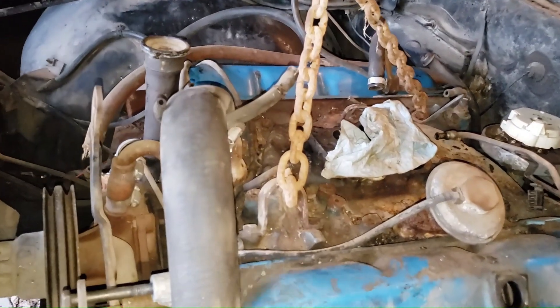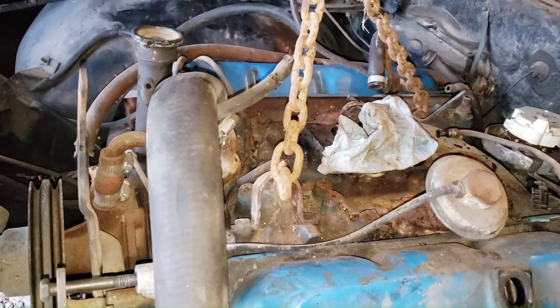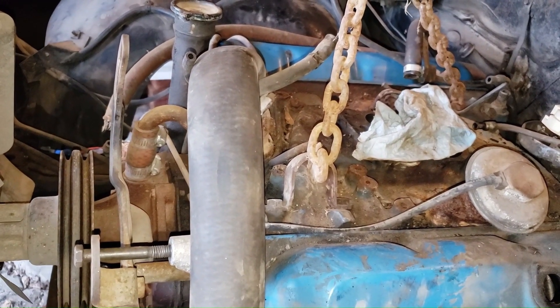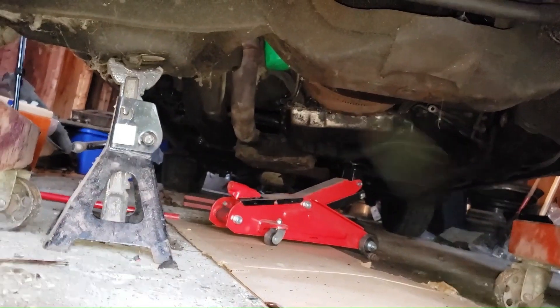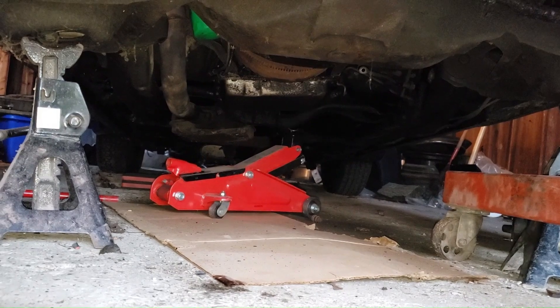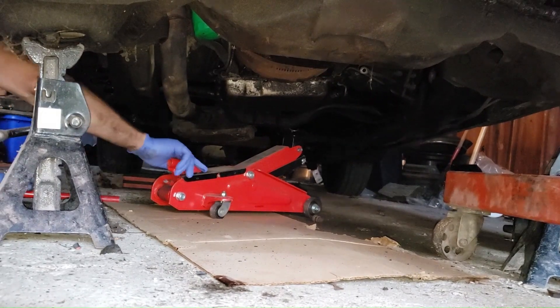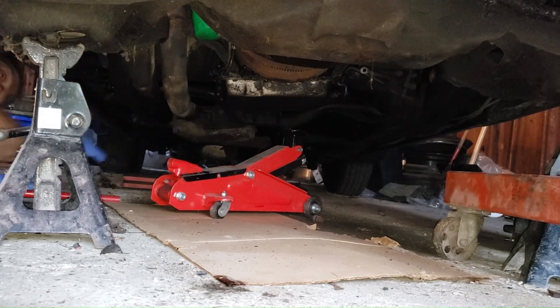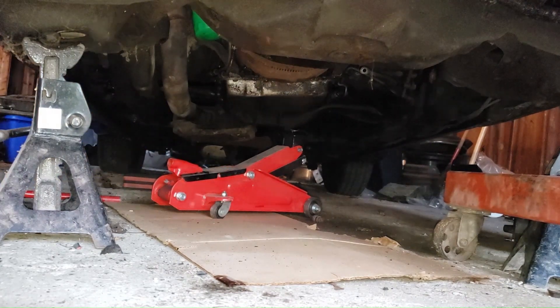We'll find out if that — oh, I've got that little jack in the back of the truck. I've got to put it under the transmission. All right, you want to talk about what that's doing? Well, right now it's not doing anything. But my plan is to put a block of wood on that jack and then hold the transmission pan so that it stays up in place.